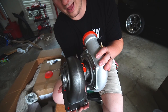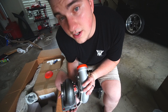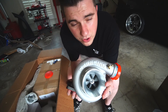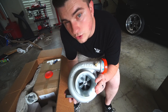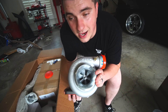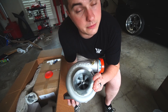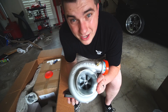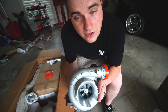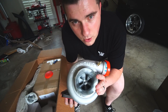It's got water and oil ports. Contrary to popular belief, you don't actually have to run water cooling — you should if you can, but you don't have to. The nice thing about 2JZs is they're big — it's a three liter motor. Unlike RBs at two and a half or 2.6 liters, it's hard to get those to spool turbos this size. You wouldn't believe what half a liter does. This turbo is going to be pretty spoolie. I'd guess it's rated to about 550 horsepower, though I have a VVT-i which is slightly weaker than non-VVT-i 2JZs. Probably shooting for 400 to 450 on E85.